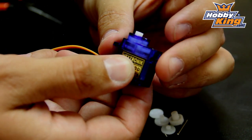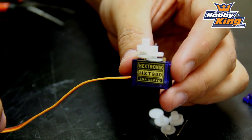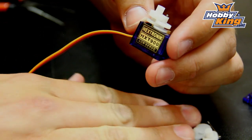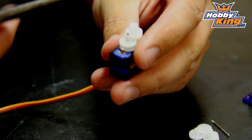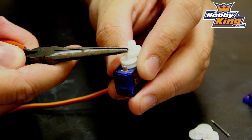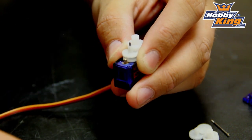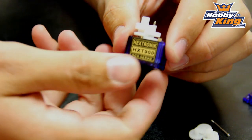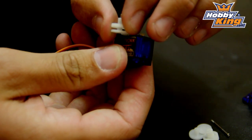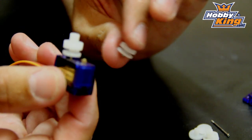There's really no true trick to getting these gears off, all four of them, but I recommend starting with the loose gears — essentially the slave gears. The best way to do that is grab the top pin on the small side and just give it a little lift. It doesn't take a whole lot, and you should actually be able to slide these off to the side. I recommend keeping these gears together on their spindle — it tends to help quite a bit, so put both aside together.